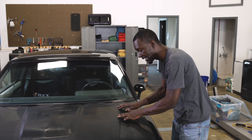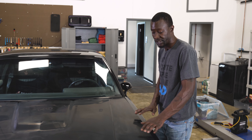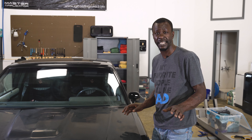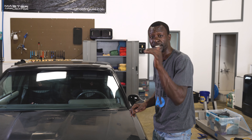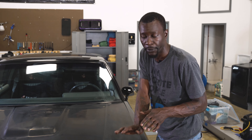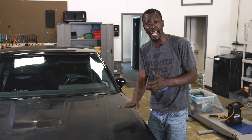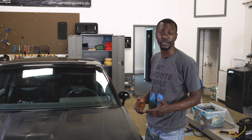I did lay a tape strip across these high spots while using the machine to wet sand those areas, because the thinnest paint on a painted surface will be at those edges and contoured areas. You never want to run sandpaper — especially a machine sander — across an edge, because more than likely you will blow through that paint on that edge relatively quickly without any effort at all. It's just that thin.